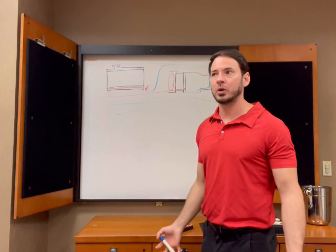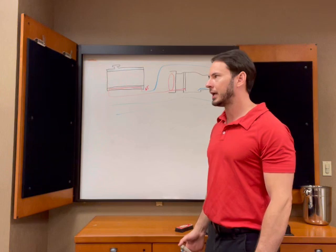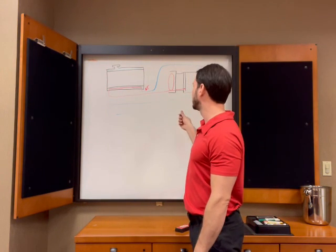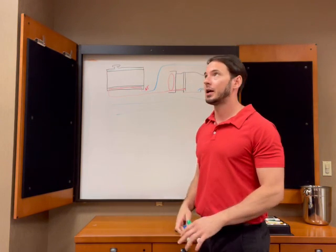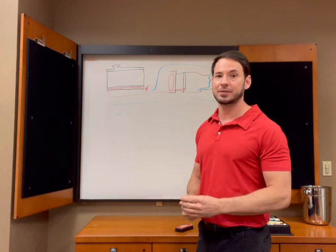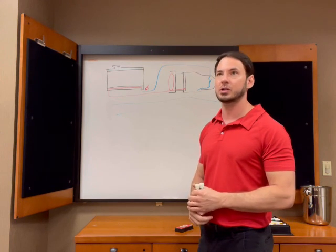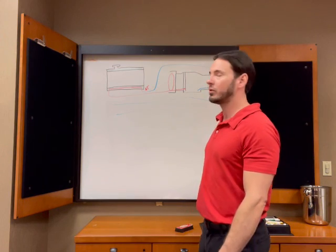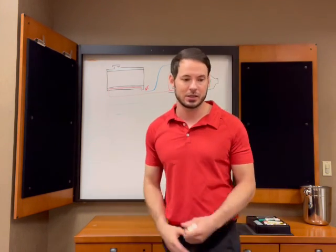I don't know who thought that AT oil temp would be useful. I haven't heard, but I've never really asked on the old Loyals if anybody ever saw it come on. I tend to doubt it. But if your AT oil temp light comes on in an SVX, somehow you've managed to trick the car into trying to run a clutch that's long since trash. It's the only way you're going to do that. And that's a bad situation.